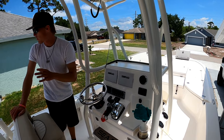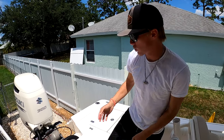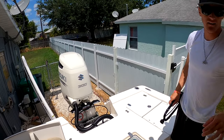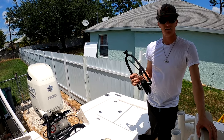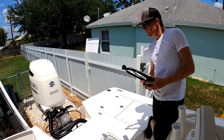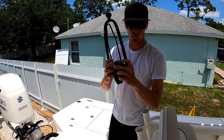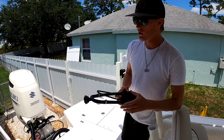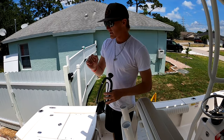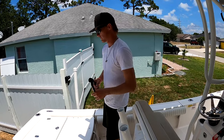We'll also be sure to run the motor with a good flush. These are the earmuffs we use to run the motor. A lot of companies when I bought the boat told me to just use what the motor provides, but we've always used these with no issues — you can really get it through the pumps. If I come back from a late night trip I'll use that, but in the morning it's the first thing I do: run the motor with the earmuffs on for about 10 minutes with a little RPM. It's a great way to make sure that salt isn't just sitting in your motor.